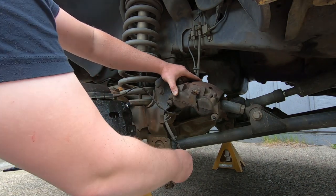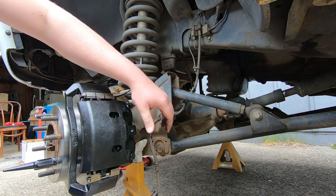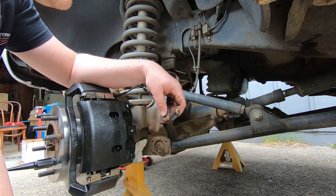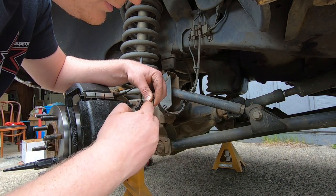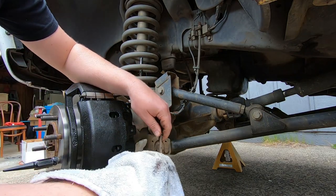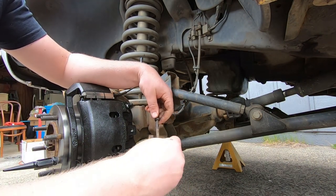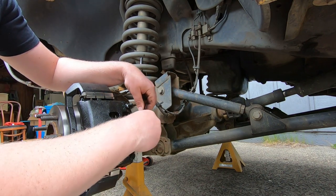Okay, get rid of the old bolt. Okay, old bolt comes off, make sure the old copper comes off. Like I said before, we do not reuse copper washers, ever. So, you put your new bolt and your copper on. I should probably wipe that off. New copper goes on the bottom, like so, and then the brake line goes back in the caliper.